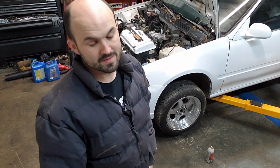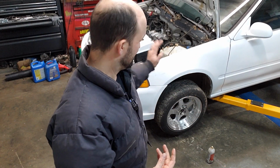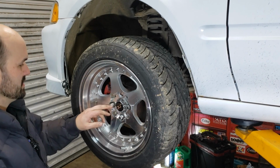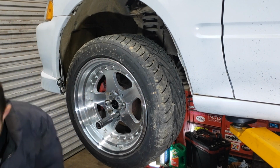Hey guys, welcome back to the channel. So today I'm going to show you how you can take the stock Civic brakes off of your EG Civic and install some DC2 GSR Integra spindles onto your EG. Alright, so the first thing you want to do is get the car off the ground, and we've got to take off the wheel. This one has aftermarket lug nuts that use a key, so I use a key.